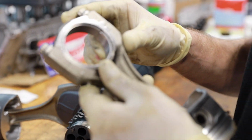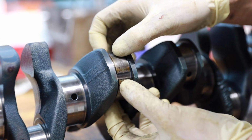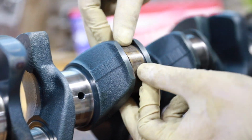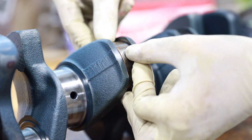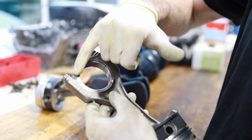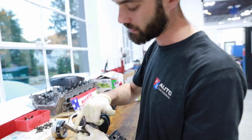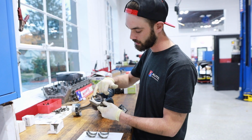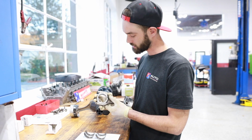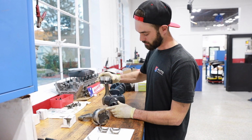Now this is how it should stay. These bearings stay in place in relation to this connecting rod. And then this bearing surface here, with a thin layer of oil in between, is what's riding on this crankshaft here. Now when you spin a bearing, this bearing shell is actually spinning inside of here, and it's spinning with the crankshaft. That's not designed to do that. So you're gonna have metal start wearing here. It's gonna wear even quicker and exponentially, and that's where you start getting that clacking noise. So that clacking noise when you hear a spun bearing is more or less like that.